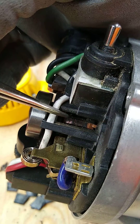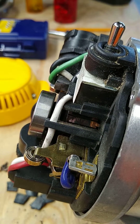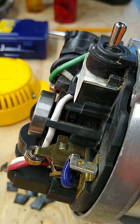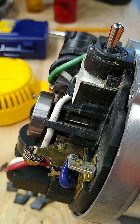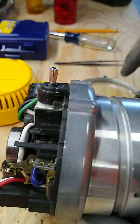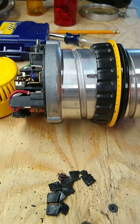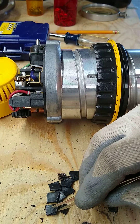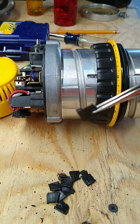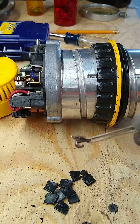It turns out, right in the middle here — using my tweezers — you can see a copper thing in there. That's not a brush, that's a commutator pad that the brush rides on. And if you turn it to here, you'll see there is no commutator pad there — it's gone. After shaking out all the debris that came flying out of the router, down in the fins I found a bunch of these, which I believe to be fins off the cooling impeller fan.